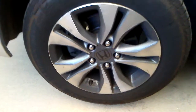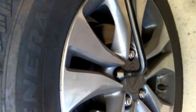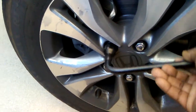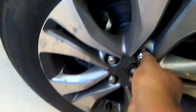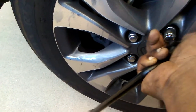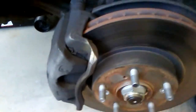We're going to get the tire off and see what's going on with these brakes. What I forgot to tell you before jacking the car up — you want to loosen all the lug nuts while the car is still on the ground. Just loosen them so it'll be easy to take them off once the car is in the air. I already loosened them before jacking up, so they come right off easily.